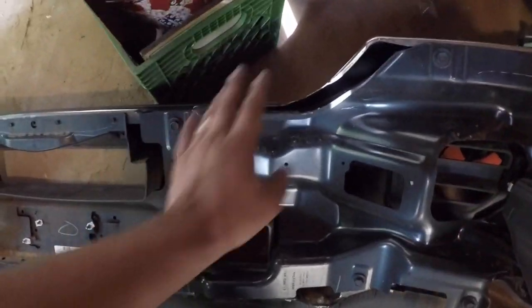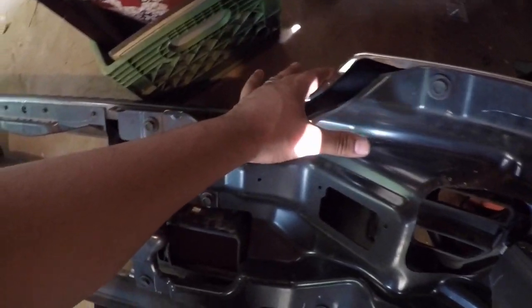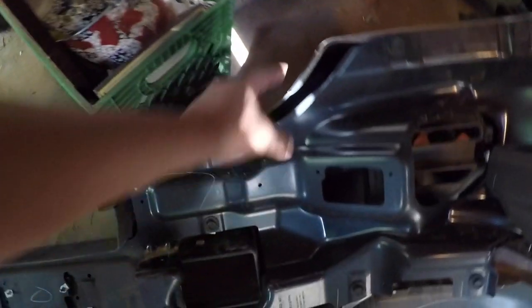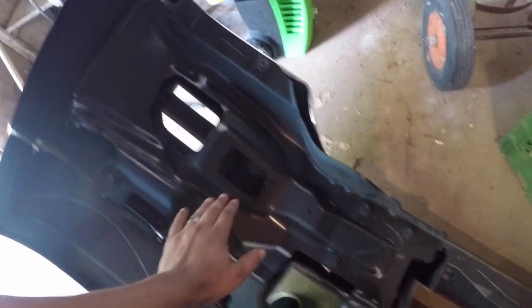And I did go buy a Dremel. I bought a couple extra things, as you could tell. I bought a cardboard box, tape, and some cutting wheels. That's because we're going to have to cut the grill to shape out to this right here. I already measured out. It's going to be about 2-3 inches in on each side that we're going to have to cut the grill. And I think it's going to be able to notch it enough to where it doesn't cut away completely at the grill.